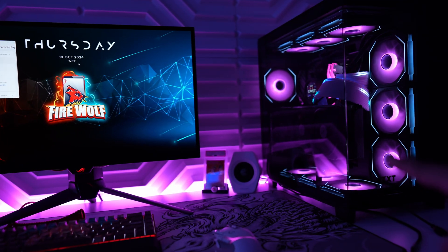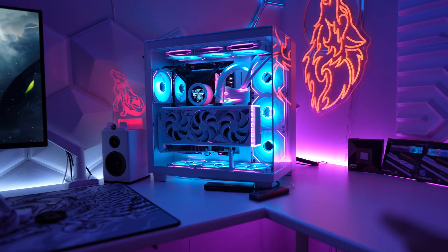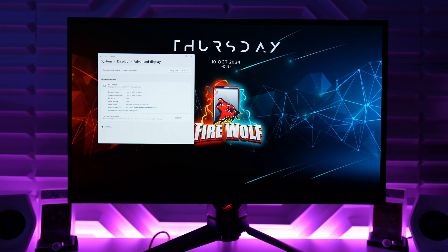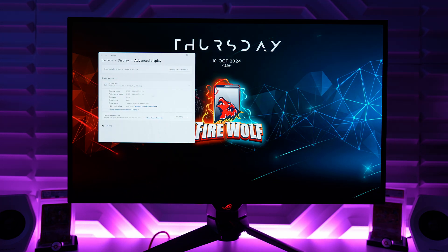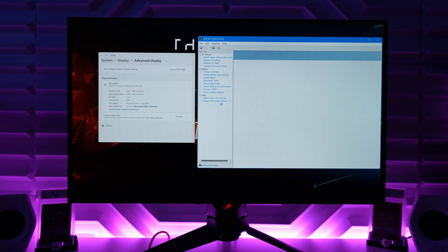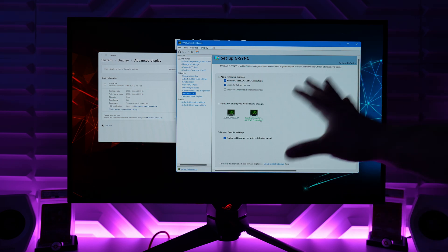I have it connected to both my black gaming PC via DisplayPort and my white gaming PC with the 4090 via HDMI 2.1. The very first thing we want to do is increase the refresh rate all the way up to 480Hz. We're going to click that and keep changes. It'd be crazy if you have been using this monitor without enabling 480Hz. Since I have an NVIDIA GPU, I'll open up NVIDIA Control Panel. What's great is that right out of the box, it is G-Sync compatible and automatically enables it — no additional steps required.